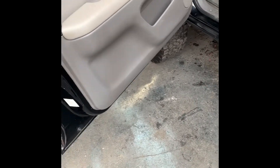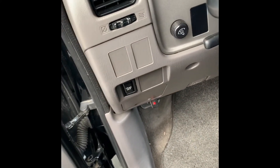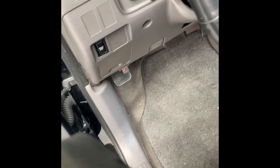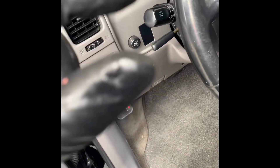We've got the car running. We checked the dipstick when the car was cold, and now the car is at operating temperature so we're going to take it for a test drive. The way to check transmission fluid level is: check it cold on the dipstick — it has two little marks and the fluid should be between them. Once you take it for a small drive around the corner and back, check it again at operating temperature. The fluid expands when warm, so it should now read in between the two guidelines on the hot side of the dipstick.